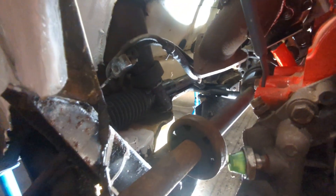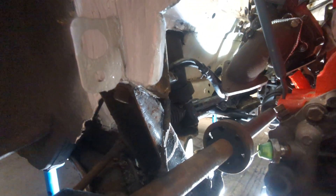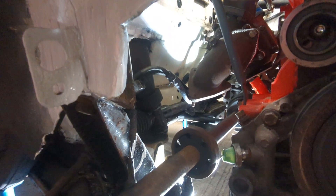It should be a lot shorter to join up because we're going from the back of the engine to the end of that exhaust I just showed you. That's the bottom of the turbo for the exhaust flange there and it's got to sort of go to the middle just behind there. I've just rested the drive shaft there as well just to make sure I've got clearance for that. It's going to be fiddly but hopefully I'll be able to use what I've got and weld together something that's going to work.